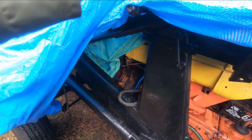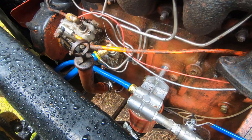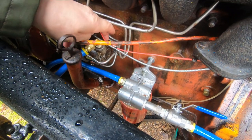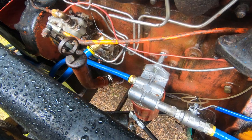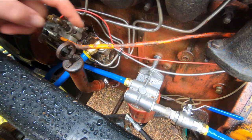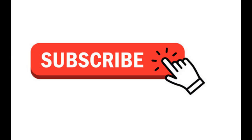Let's get in here and get another idea. I'm going to take the end off the pump and check a couple of things. I got an email from a guy who pointed out that there's a little piston that runs in this hole right here under that plug. There's a piston that runs in there with a spring, and maybe that's preventing the proper amount of fuel from getting into the lift pump and on the end of the injection pump.